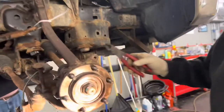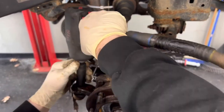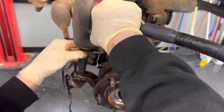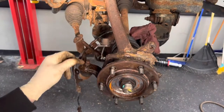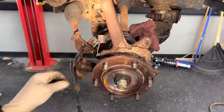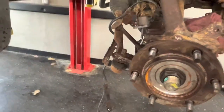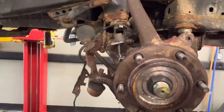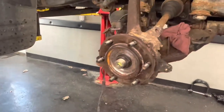Right now we would be able to remove the axle if we just pulled this down, but we've got to disconnect the tie rod to get it back. We went down to a 17mm and the cotter pin was rotted, so if we want to reuse the tie rod we're just going to have to drill it out, which we can do. I got that off - this thing is just a mess.